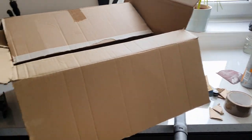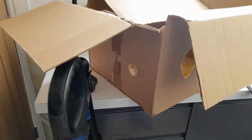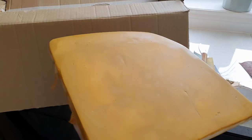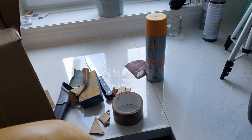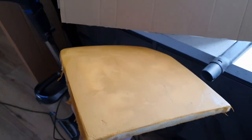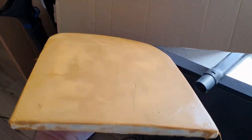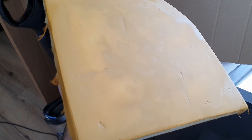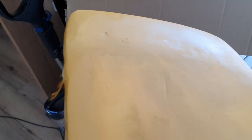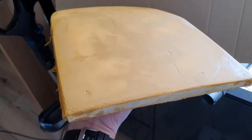Right, so this is day three. I've built myself a wee box where I can hold the hoover to pull the sanding dust out and keep all the sanding and paint in one area. I've hit this with 100 grit sandpaper after the filler — that was the last bit I filmed — and then I've hit it with a filler primer. It's coming out not too bad. I've tidied up the sides but as you can see there's still quite a bit of texture in the corners and a couple of wee bits of pitting, so I'll hit it again with sanding and spot filler if needed.